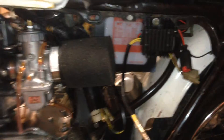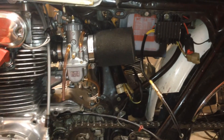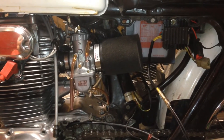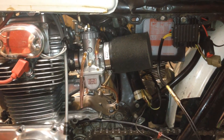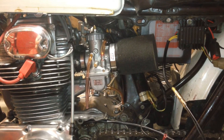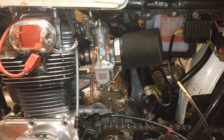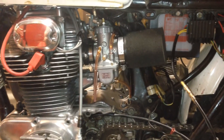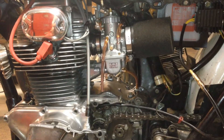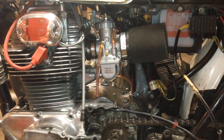Other than that, I don't want to try it out because it's a bit late right now, but I'm sure it will just work just fine. You end up reducing a lot of wires — everything's just a much better quality. I like having a high-quality voltage regulator, keeping my battery in good condition, same with the rectifier and the stator. I can confidently run that 55 watt halogen light and have plenty of power so it's not sucking juice away from even my ignition. This will actually probably add horsepower to my bike, especially at the higher RPMs and even at idle — a better, more consistent idle right from the start and probably even better startup. I gotta say I'm pretty impressed. It took about an hour, I took my time — nothing too hard.